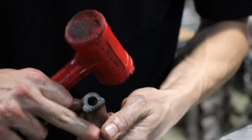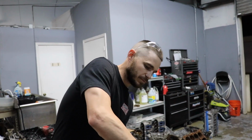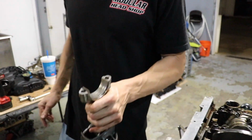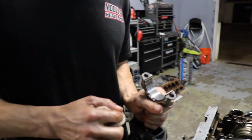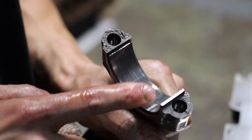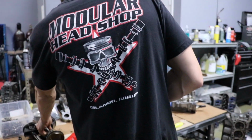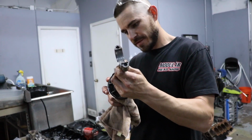Not bad. You know, I don't think I've actually seen too many voodoo teardowns. Most of the failures, people ended up doing a warranty replacement. Alright. Now, here you go. I would say that right there is detonation. You're pounding that bearing back into the crankshaft. Yeah, it's not bad, but that's a sign of it for sure. With these being such high compression, that's why 93 is just... 93 is not good for this kind of compression.